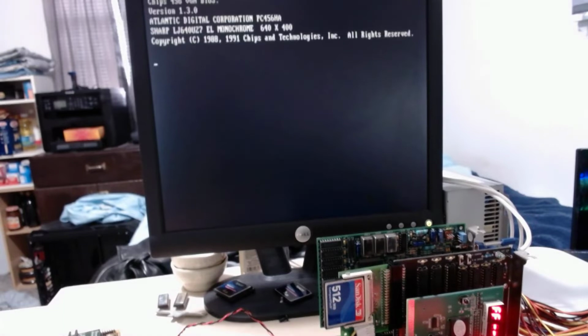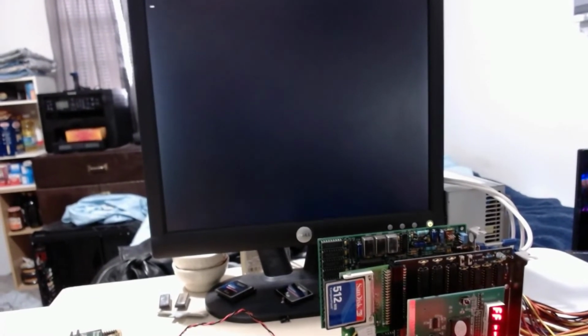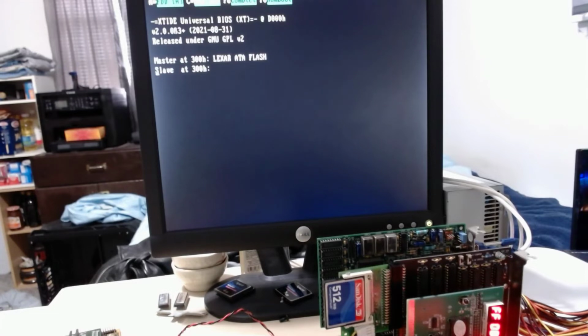Long and 2 shorts. But as you can see there, that's the VGA BIOS coming up. There's no memory test like there is on my 5160 boards. Maybe that just doesn't happen on this board. Still a 601 error.